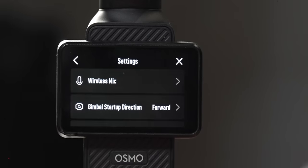In the transmitter settings you can turn the LEDs on or off, and toggle vibration — the DJI Mic 2 gives a little vibration depending on the mode, so when you click backup recording you'll feel a vibration on the transmitter. There's also an option for audio-to-video sync — when both are powered on and linked, if this option is on, whenever you hit record on the Pocket 3 it will automatically start backup recording on the DJI Mic 2 transmitter, giving both the same timecode. You also have a low-cut filter and 32-bit float recording for more dynamic range and editing flexibility.